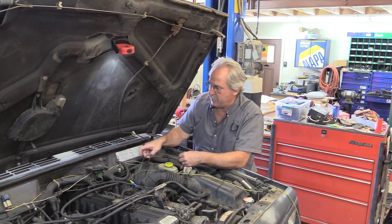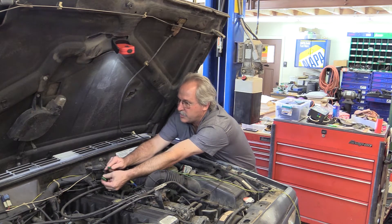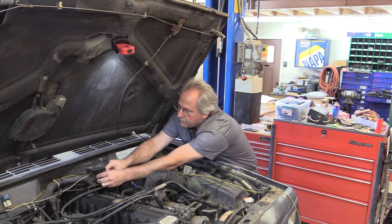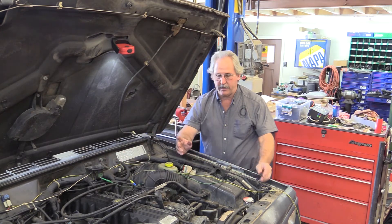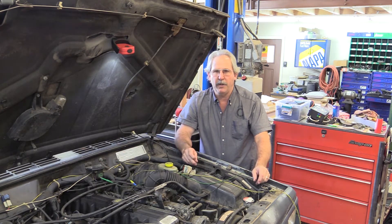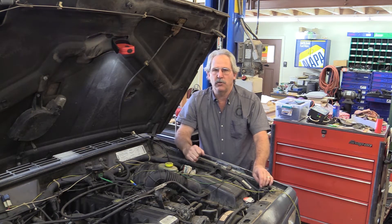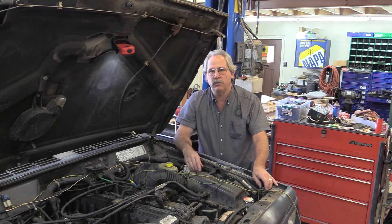Got that connection — it was pretty deep. I'll do the same thing with the green wire. Because it's a little harder to reach I can take the connector off, back-probe it, and reconnect it. Now I can turn the key on. We're going to set up the scope first, then turn the key on, look at our signals, do our key-on engine-off TPS testing, and then start it up to see how the MAP sensor responds as we rev the engine and come back to idle.